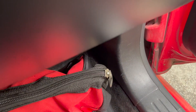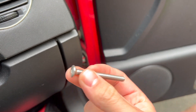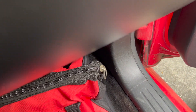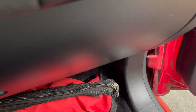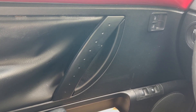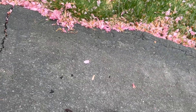What I'm going to do is take the Dremel tool with a little one-inch cutting wheel and cut away at that until the new handle can sit flush. With the new handle I got these aluminum spacers with what appears to be a stainless countersunk hex cap bolt — it's a 5/32" bit — so I got that in the ratcheting screwdriver. The driver's side original factory plastic door handle is still intact, so I'll leave it until it breaks or change it out at the same time.